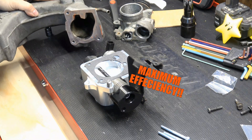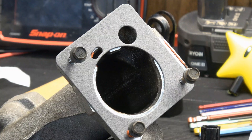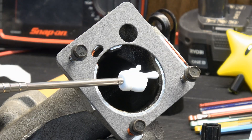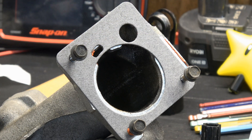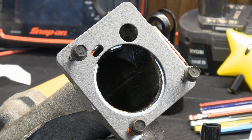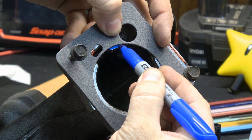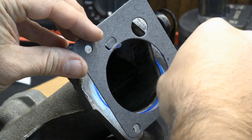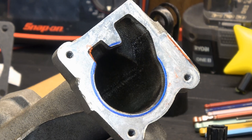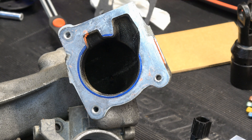What we have to do to get maximum efficiency is we're going to need to port it, which is a job I understand is not for the faint of heart. So that is the intake with the new gasket on. Notice how we have these edges here that stick up into the path of airflow — we need to knock those down and make this all one continuous, smooth path for the air to flow through. What we're going to do — and there are many different ways to do this — is take a sharpie, make sure the gasket is lined up just right, and paint the inside of the gasket with the sharpie. Then we need to take a grinder and grind all that excess material away. This is where the term port and polish comes into play. I'm not going to be concerning myself so much with the polish aspect, but certainly the port, so that we have smooth flowing air down into the intake.